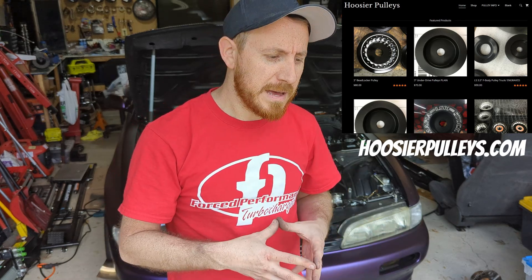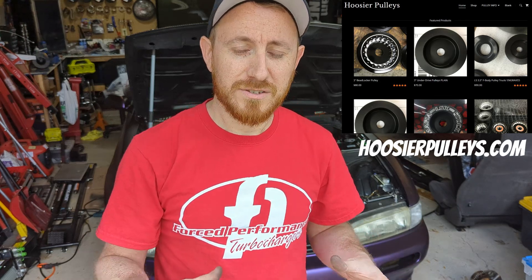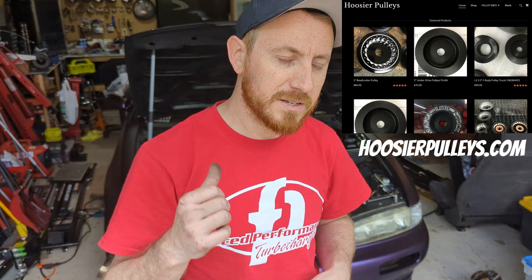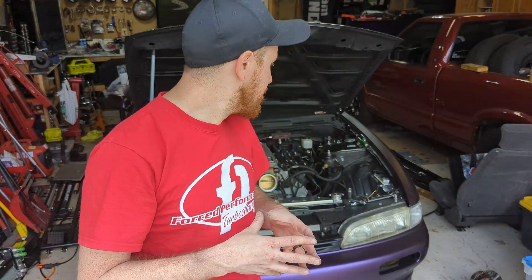Hopefully that helps explain what's going on. If you're running into voltage issues and before you destroy the alternator like I did, go ahead and get that larger pulley on there. Check out Hoosier Pulleys — the pulley on mine is just a blank, standard black coated, but he does offer some pretty neat special engraving. My idler pulley is an example of the engraving. Joe also has three-piece sets for the idler, alternator, and power steering. Lots of different size options — if you're not sure, check him out on Facebook and he'll explain which one you need. Hopefully this helps keep your alternator from dying so you don't have any problems charging going down the track or just driving in general. If you like this video, be sure to check out some of these other videos and subscribe to the channel — thanks for watching!